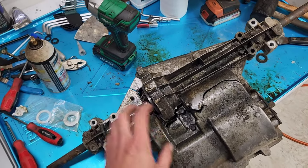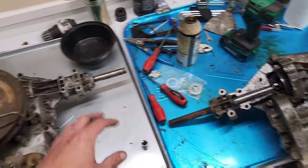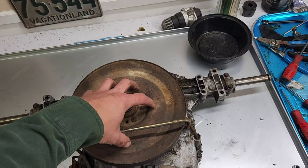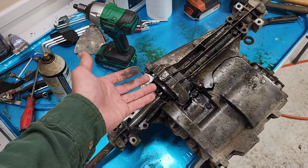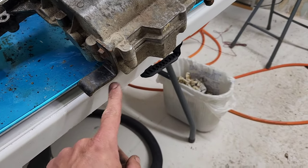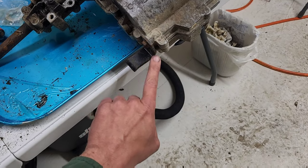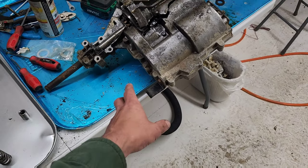Somebody didn't take my advice. On the back of the machine there is a plate, and people get lazy doing pulleys — they take off the back plate to see in easier, then leave it off. The whole thing flexes, and when it torques up you blow the bottom of the transmission to smithereens. Also, those little front brackets — you need to weld triangles into them to reinforce them, or put a piece of plate across to make one triangular piece. They're always broken there if you off-road them.